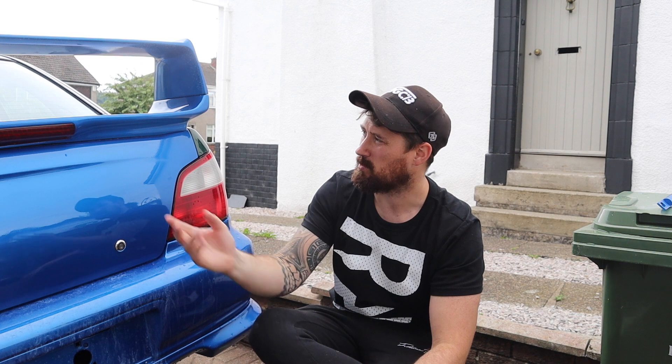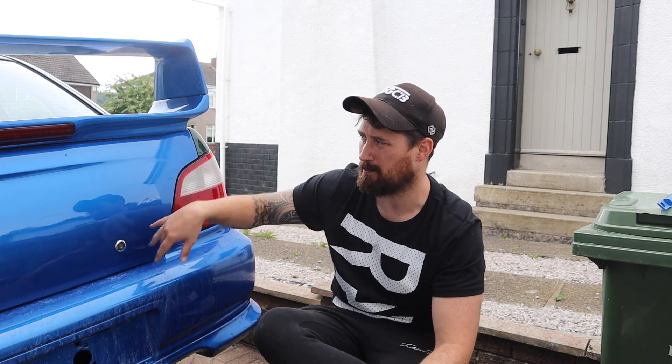For not a lot of work - that probably took me about an hour's worth of time to do that back quadrant. There's going to be a lot of work when it comes to doing the full car. My sander is a six-inch sander so I'm probably going to need to get a small three-inch one to get into all the contours. Really pleased with how that's turned out. I hope it gives you the confidence that if you've got bad orange peel, you can go out and get it sorted yourself. This is by no means a guide - this is my process. I'm not a professionally trained detailer, I'm not a professionally trained spray painter. This is just the way I've always done it.